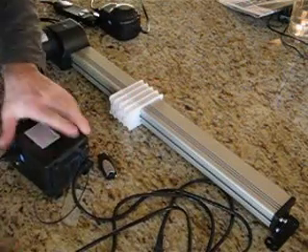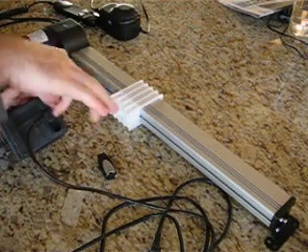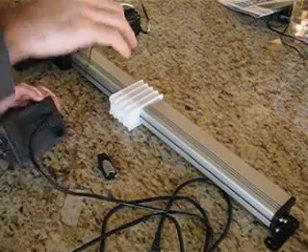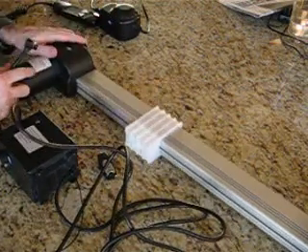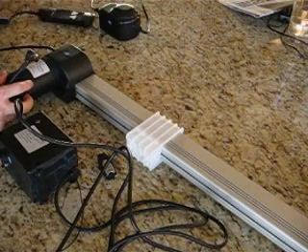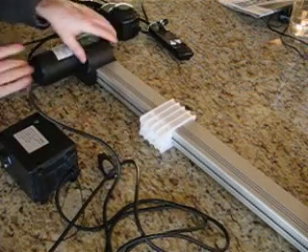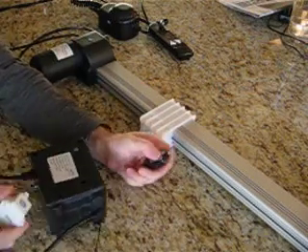The microswitch has two wires. One gets plugged into this controller and there's only one plug it can fit into, so you can't go wrong. This is just an antenna for the radio frequency remote control. Then the other end plugs into the actuator where the old wired controller plugged in. So we'll disconnect that because we don't need it and plug in the new one. If we press the buttons on this it should now work.